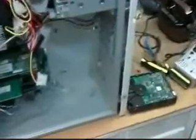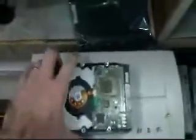I think the power supply might have a slight short, or something's not allowing it to handle the voltage that it should. So that's probably why it's shutting down. What I could do, excuse me, just out of curiosity, to see if maybe it is the hard drive, maybe drawing too much power, I can try another drive, because I got one down here. I don't know what's on it, but I think this drive wasn't working too swift either.